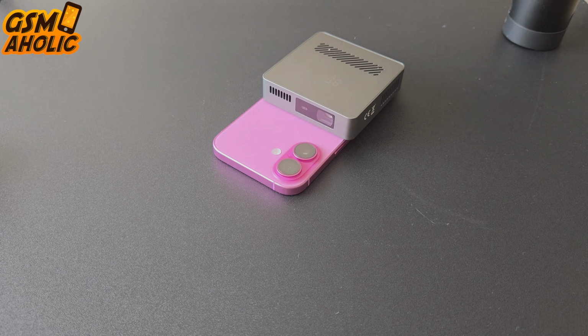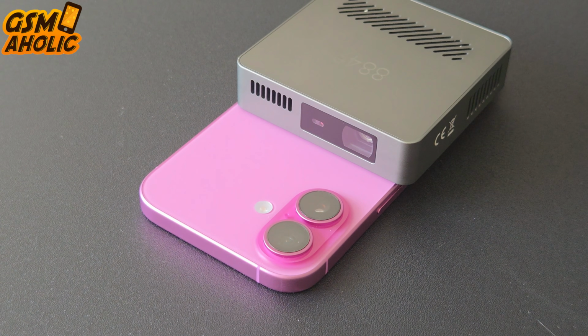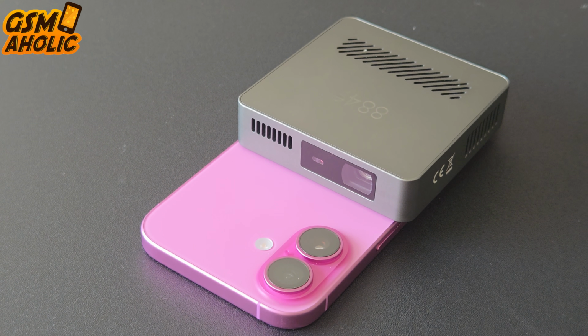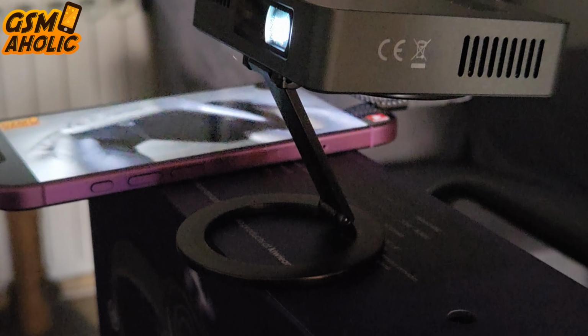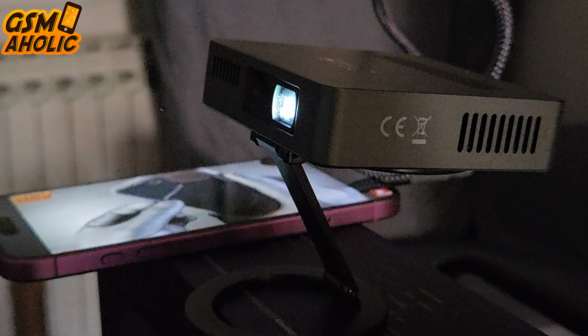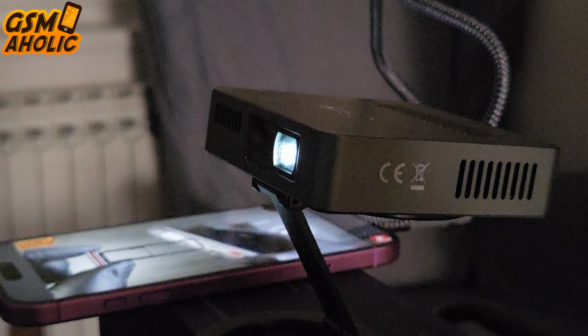Older iPhones with Lightning actually can't power such a device without a power adapter. Our newer iPhone 16 could do it without any problems. In conclusion, count on two cables in most cases, one for the video, one for power. This slightly reduces the impression of a one-cable solution but ensures stable operation.